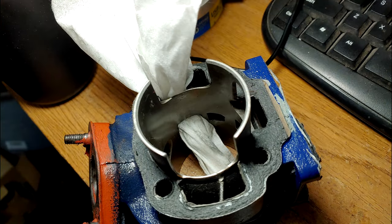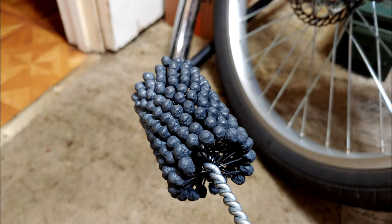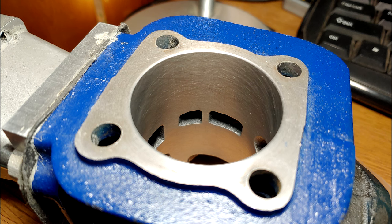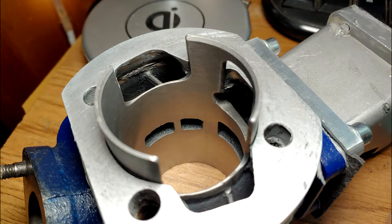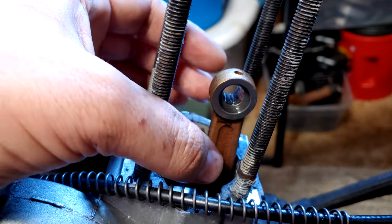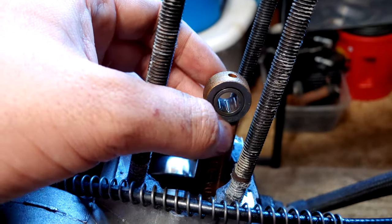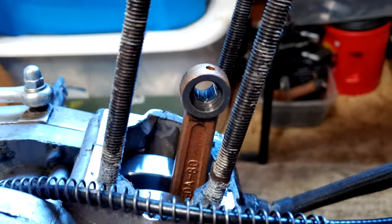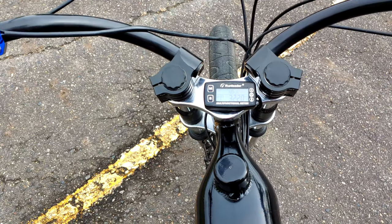Not knowing how severe the damage to the cylinder was as far as bore diameter is concerned, I went ahead and rehoned it very lightly, just enough to get the cross-hatching back. I then very thoroughly re-cleaned the cylinder, ensuring that I got every square millimeter of the transfer and intake ports. Knowing that some of this polishing compound certainly got into the case, I removed it from the bike, took it outside next to a running water hose, and rinsed out the case with gasoline about a dozen times, until I could only see fresh blue gas mix coming out of the case.